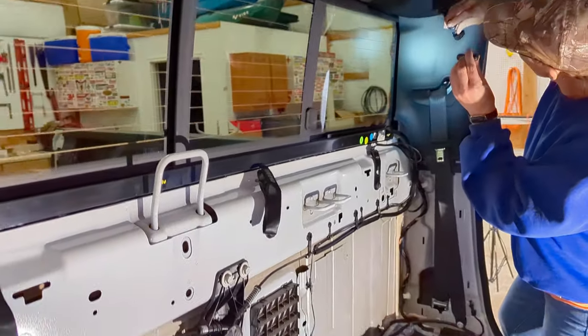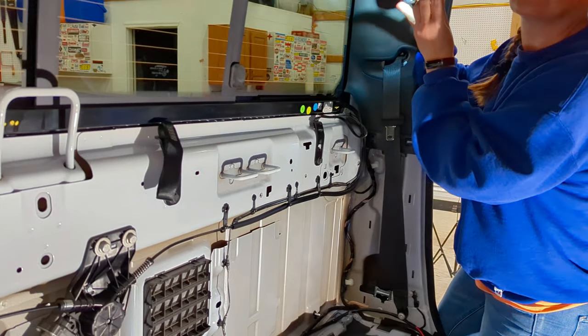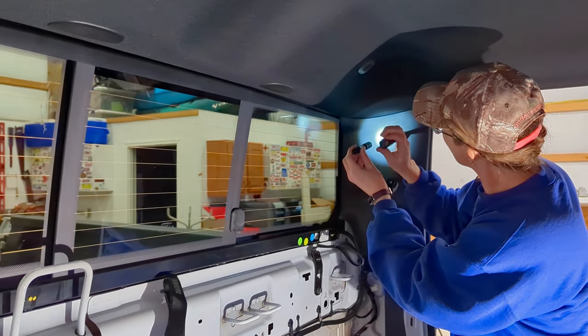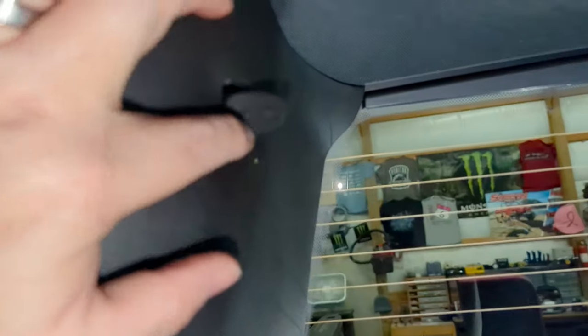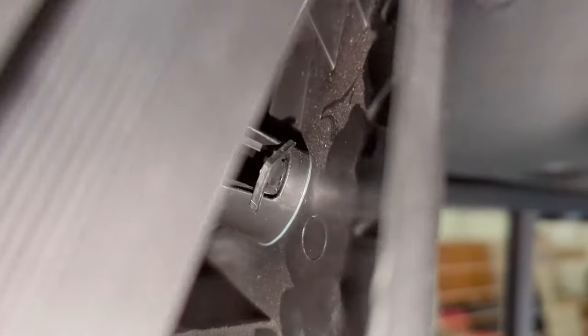Okay so we're mid-process - everything here has been pretty cut and dry. The rear pillars, the lower was all push pins - you could just literally give it a good yank straight out. Most of the upper is the same way, however for our truck behind this little airbag cover is a Torx screw. So this was all push pins behind this panel with the exception of right behind that little airbag - I put needle nose pliers on that, pushed forward, that pops this little door open, and then behind that door is a little screw to get that panel out.